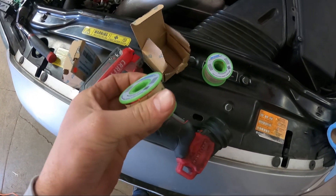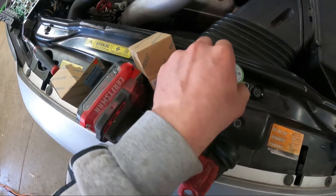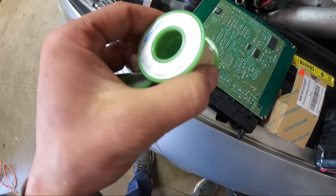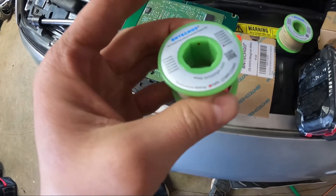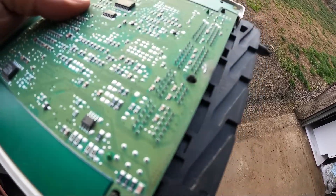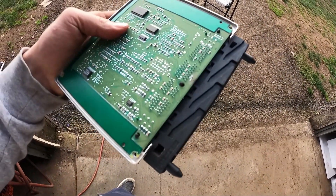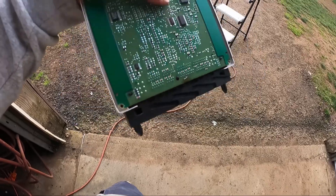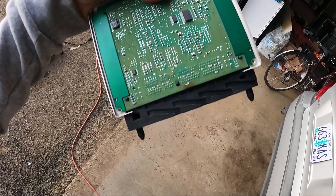For soldering this kind of stuff you need some high-quality magnet wire — AWG 28 and 38. By the thickness of that track, I'll most likely end up using the 38 AWG magnet wire, since that track is really skinny. As you guys can see, I got some protective coating on it — not necessarily a masterpiece, but it looks connected. Everything is good, and it's protected so it's not bare wire.